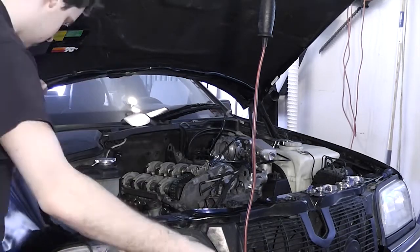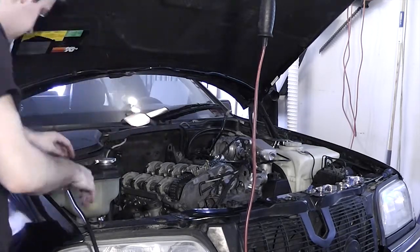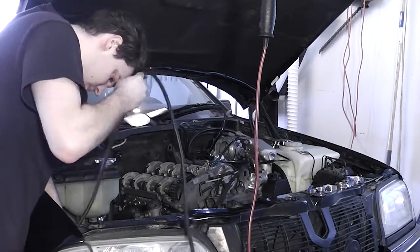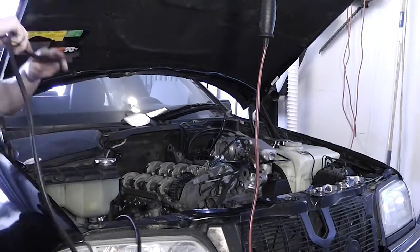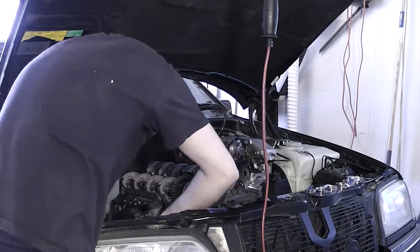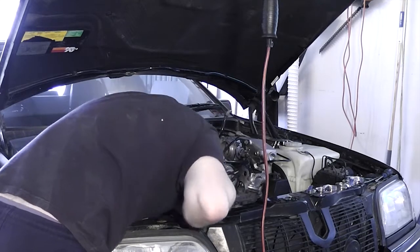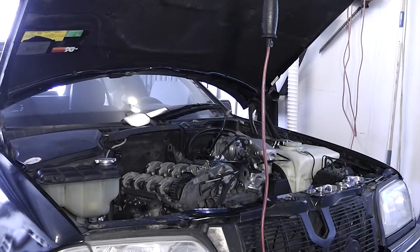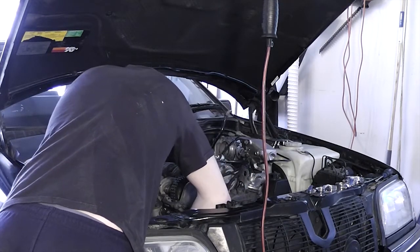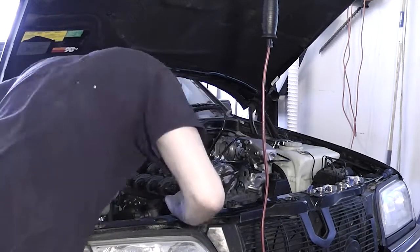Because of a messed up internet order, I ended up with 4 meters of spare overflow tube, so I decided to solve a small convenience issue. The coolant expansion tank's overflow dumps on the wheel arch, which seems fine at first. However, if you put too much coolant into the system, the overflow quietly runs down the wheel arch under the airbox and pools under the auxiliary water pump. So when you check your engine for leaks, you think you've got a leaking auxiliary water pump. To mitigate that, I ran a new overflow tube along the fender, under the headlight, and into the wheel splash guard, where there was a convenient little drain hole already made. This puts the overflow far from other sources of coolant, so now we can know right away if there's a leak or if it's just excess coolant draining out.